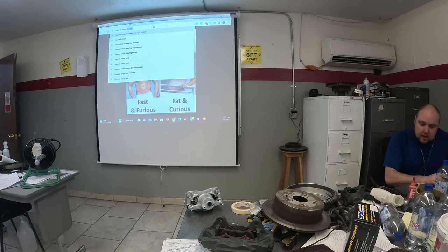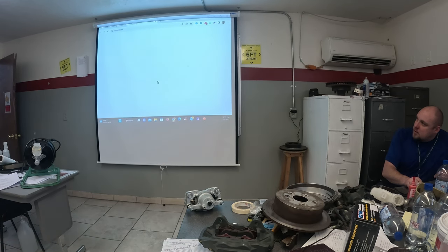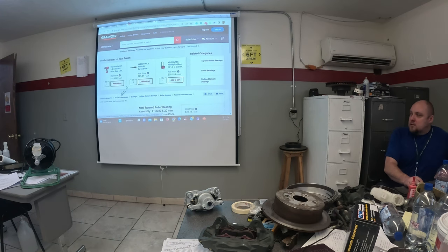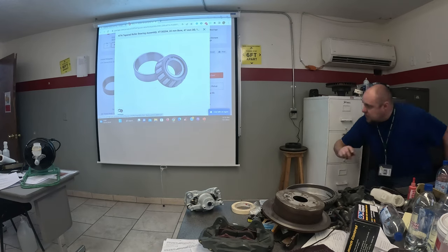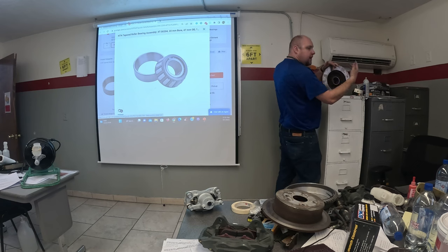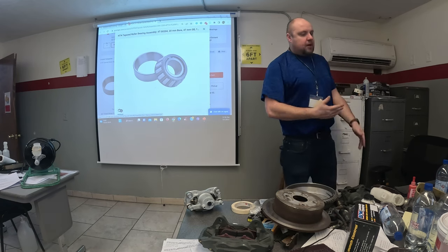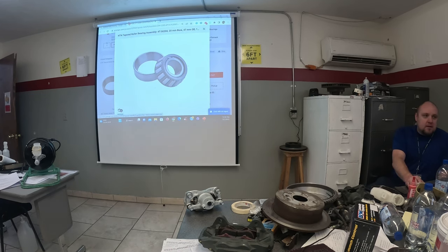That race is the part you had to hammer out. They come as a set. Some people would only replace the bearing itself and try to reuse the race inside. But they weren't built together — they might have been made by different factories, different manufacturers — or even the same manufacturer, it doesn't matter. These things are a matched pair, so you always have to replace the race. The ASE answer choices might say: replace the race by itself, replace the bearing by itself, just repack it with grease, or replace the set. The correct answer is replace the set — even if it was only one damaged roller.